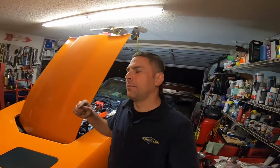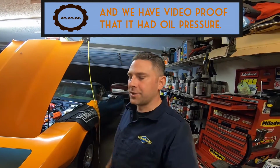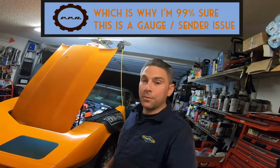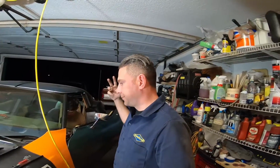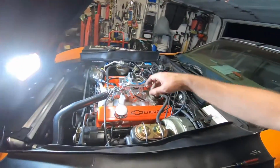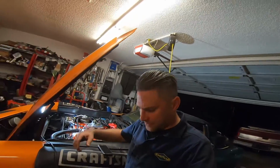We do have an issue. Mikey did say he thought he might have broke the oil pressure sender. We're not getting any pressure on the gauge. That's why we fired it up and cut it right off. We're just going to go ahead and replace the sender. But, boom, done. So now we're going to close this out. The next video you see with this is going to be tuning, timing, cleanup. We're going to test and make sure that the air cleaner fits and the hood can close, and all that other good stuff. So fitment specific Corvette things and whatnot.